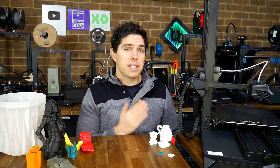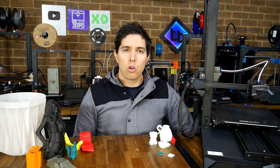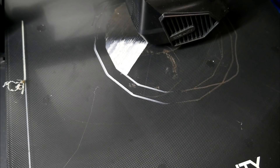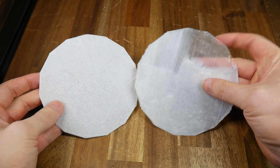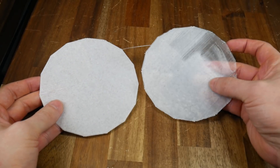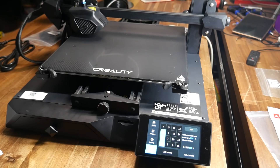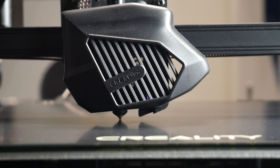One of the features that gives this printer its smart title is the auto bed levelling system, and unfortunately it was a complete disaster. I noticed from the very first prints from the SD card that the first layer was nice on the left but far too close on the right, and was damaging the bed. When it came to the larger vase, I was running into multiple failures. So clearly the glass bed was tilted — but this shouldn't matter, right? This printer is advertised as having advanced auto bed levelling. Well, based on my testing, no compensation for an uneven bed is ever applied.